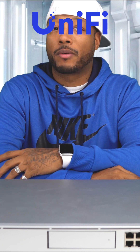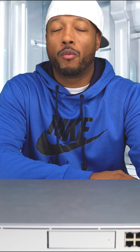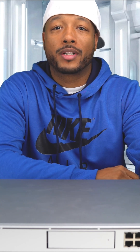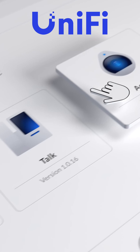You'll find one 10-gigabit SFP+ WAN port, one 10-gigabit SFP+ LAN port, one RJ45 WAN port, and eight RJ45 LAN ports that are also 1-gig capable. These SFP+ ports support 10-gigabit throughput, making this device ideal for high-speed uplinks to switches, fiber ONTs, or other core aggregation.